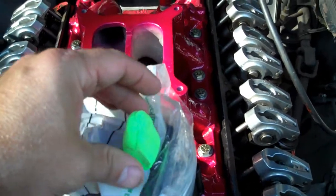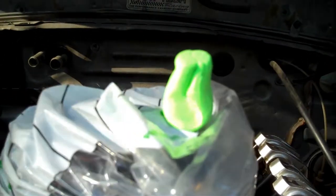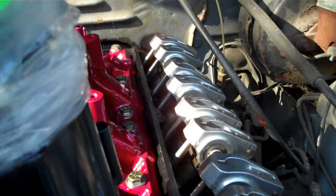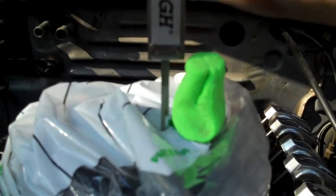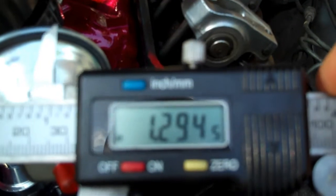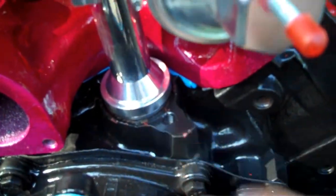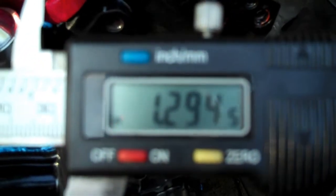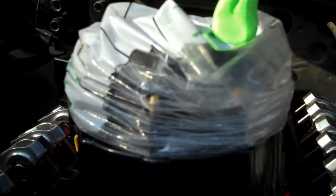Just out of curiosity, let's stand the putty up taller - about an inch and a half - and close the hood again to see if it mashes it down. There we go - you can see it kind of mashed the top flat, and it didn't stick to the hood at all. Now measuring with calipers to the flat spot on the putty, it looks like I've got an inch and a quarter of clearance between the top of the distributor and where the hood contacts. Plus the quarter inch when the distributor fully seats, that gives me about an inch and a half total clearance - question answered.